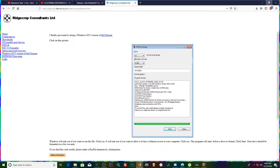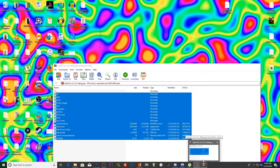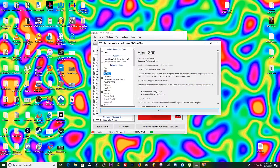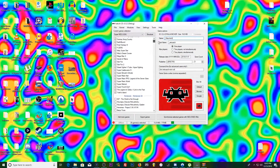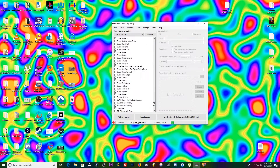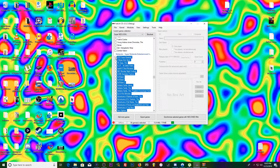Once you've got the adapter and your flash drive formatted to FAT32, you're good to go. If you want to add games to your flash drive instead of having them on the SNES classic's internal memory — space being a pretty good reason — here's how you do it.